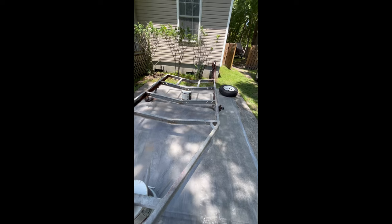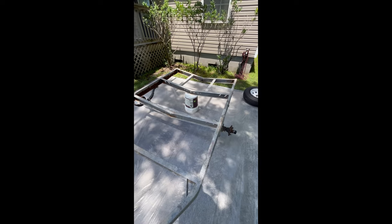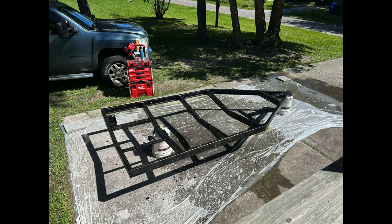I'm going to grind off all the corrosion on the galvanized trailer and then bed-line it. I forgot to take video during this portion, but I went ahead and got the axle off, began grinding down the rust and corrosion, then picked up a Herculiner truck bed kit from Lowe's. I did two coats on the top, and in the next clip I flip it over and do another two coats on the bottom of the trailer.